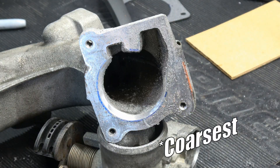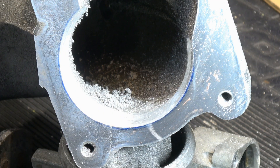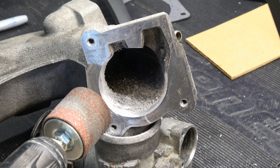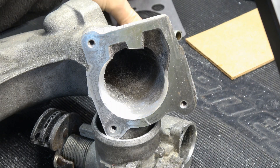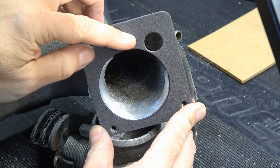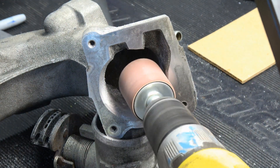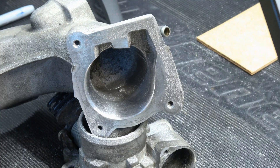I'm just starting with the biggest one and working my way down. Still got some blue around the edges, but we're certainly taking some material off now. I am making a mess — we're almost there. I'm going to switch my sandpaper out one more time. I think the port portion is pretty close to being done — let's test fit. So with the mounting bolt holes lined up, I've got the outer circle. Maybe do a little bit more over here, but for the most part it's pretty good. Now I just need to work on the polish part, which is finishing it out. Now it's nice and smooth right there — that looks great.